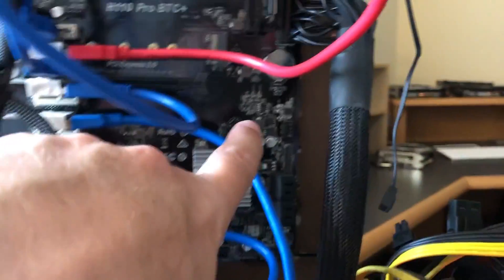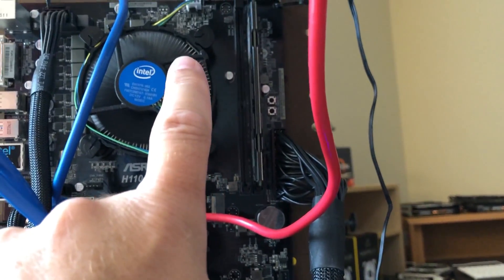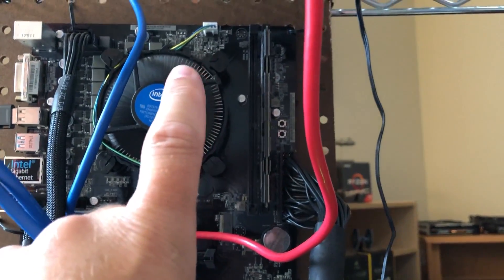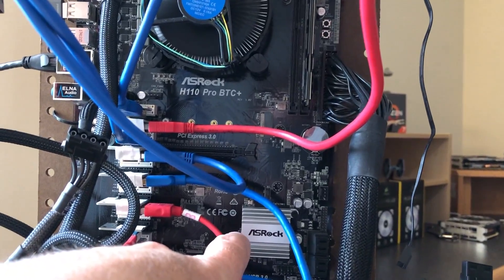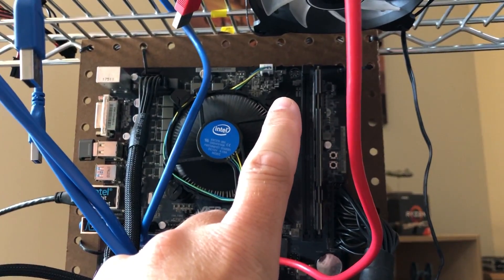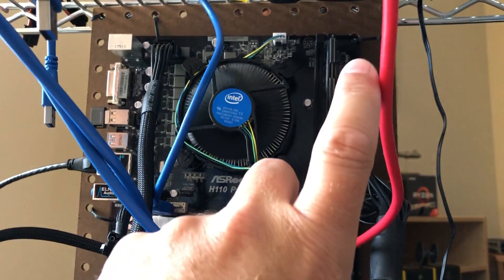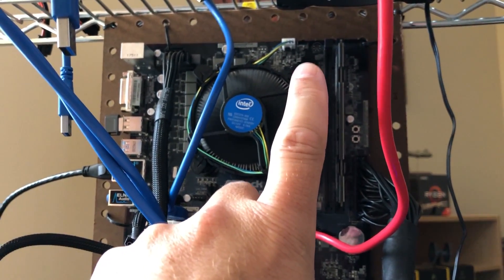Keep in mind fan draw depends on what RPM settings you have. On these motherboards, each three-pin or four-pin port will actually have different power settings. This H110 only has two fan ports that I can find. Usually you'll get three or four or more on these boards, and you can use a splitter outside of that. What I like doing on my rig builds is using one of the higher-powered, higher-RPM ports designed as an aux CPU fan port, and bringing my fan hub — maybe five fans connected — into that one port. That way I've got everything spinning at really high RPMs and I'm getting that heat off.